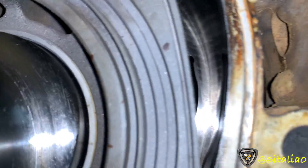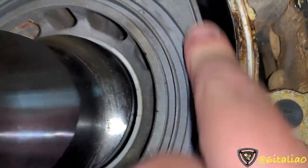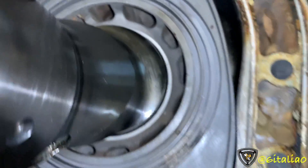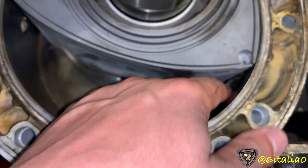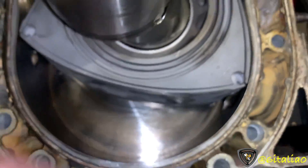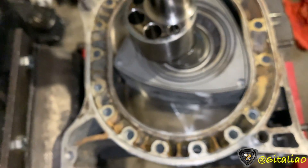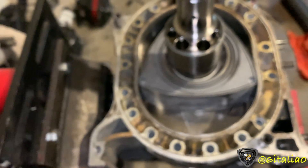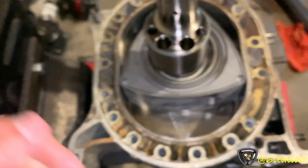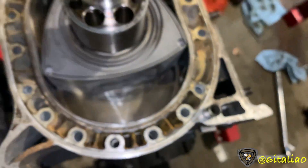That's how much the intake port is open — actually more than that, because this edge chunk is covering where the side seal goes. If this had peripheral exhaust ports, even these tiny little REPU ports, there would be a fairly noticeable brap noise. And the more you port up, the more brap noise you get — which explains why my half-assed S5 Rider Killer B, with excessively large exhaust ports ported very far up, has a very noticeable brap noise.